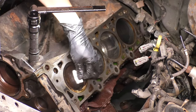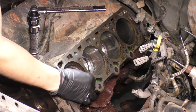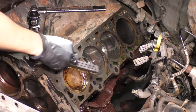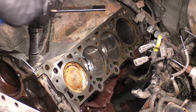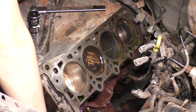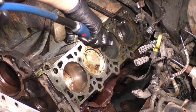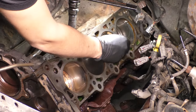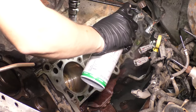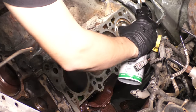This is bare metal. As you can see, I'm cleaning up the pistons. Like I said, this is completely optional. You don't have to do this. I just did it because I wanted it to look pretty. That's basically, to be honest, my only reason. You don't have to do this whatsoever. And if you have a really badly blown head gasket and coolant is being burnt in that cylinder, this is what your piston will look like compared to the dirty one. You'll have a very clean cylinder, and that's because the coolant will get in there, and as it's burning, it will clean up all of that carbon buildup, all of the gunk and debris that's stuck to the piston. So that's how you know that you are actually burning coolant. Now, I wasn't, it was starting to, but it wasn't actually bad. So if you're going to do this, just do it across all of them. That way they're all even. Make sure you blow everything out so you don't get debris stuck in there.